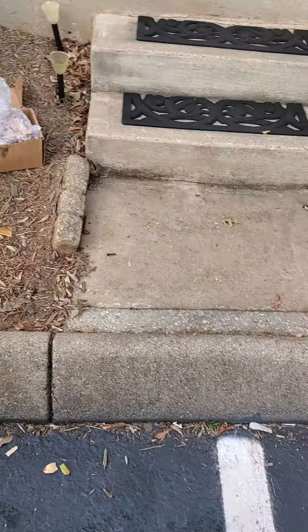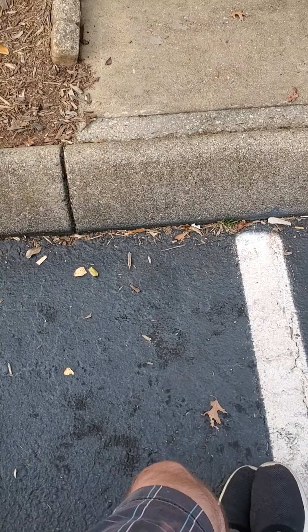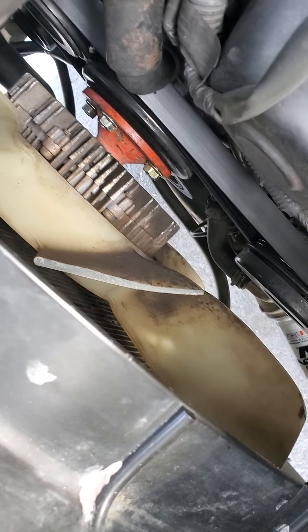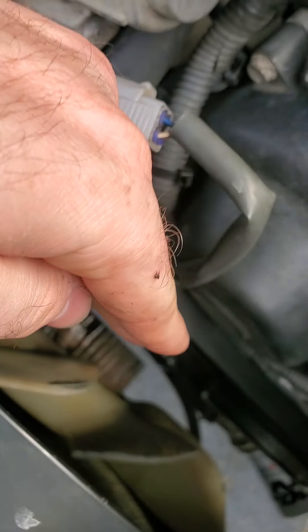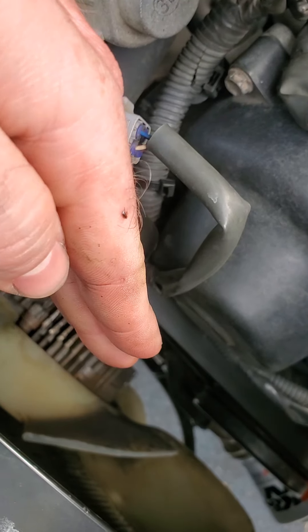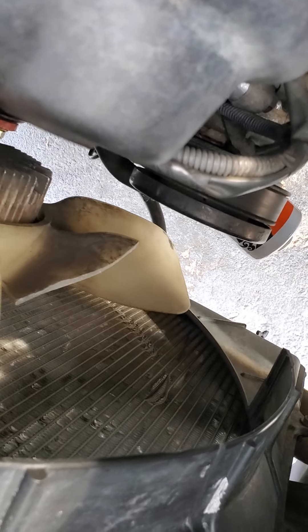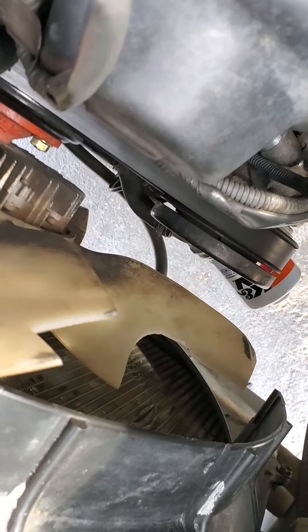But I've got the power steering pump. I ordered an ASIN water pump to go in with it, along with the fan bracket pulley and a fan, because when I replaced the fan bracket, you can see that blade's missing because it's a piece of junk. The bearing on it was worn, causing it to shift and articulate, causing the blades to hit the radiator. You can see down there — there's a big scrape. So there's one missing blade and then a couple of them are chipped.